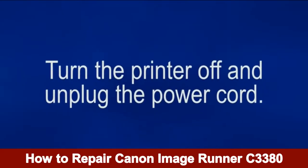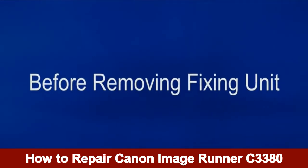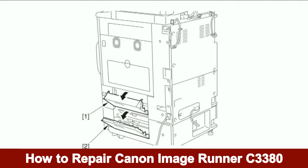Printer off and unplug the power cord. Open the cassette upper right cover as illustrated in call out number 1. Open the cassette lower right cover as illustrated in call out number 2.